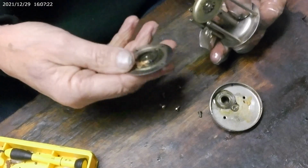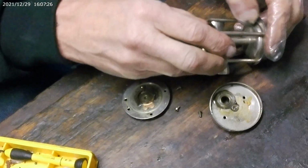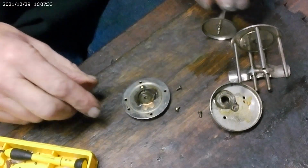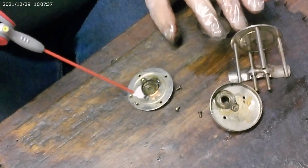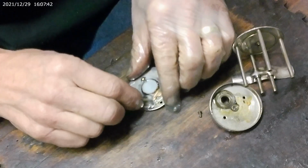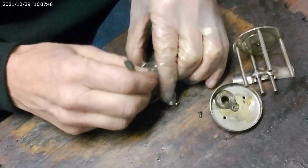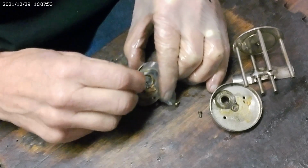Okay, let's take this off. You can see why you want to get to the back end of this. There's a lot of dry grease there. We pulled that little slot out, so we can remove the spool. We'll go ahead and clean again. We're going to use a penetrating oil here to dissolve some of that grease. Staying with our theme of don't get too aggressive with your cleaners if you don't have to, but a penetrating oil will clean all of this up. So let's make sure we did that.